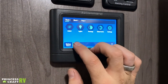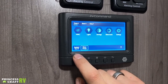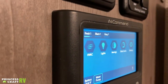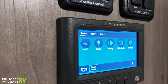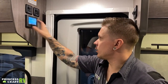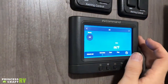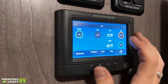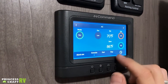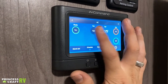On the main mode screen, we have your water pump on/off switch, and it's also going to give us a battery voltage reading. If we come up here, we can look at the tank monitors — it's not an exact science, but you have a bar indicator that will indicate the level of fullness. Going through these settings, the actual modes you're controlling through the InCommand center include HVAC — you can go on and off for the fan, set your temperature up or down, and schedule a start and stop time. You have full control over the air conditioning, including fan speed. If you set fan to either low or high, that fan will run indefinitely even if it reaches the set temperature. If you hit it into auto, it runs more thermostatically — it will reach a temperature and then shut off.